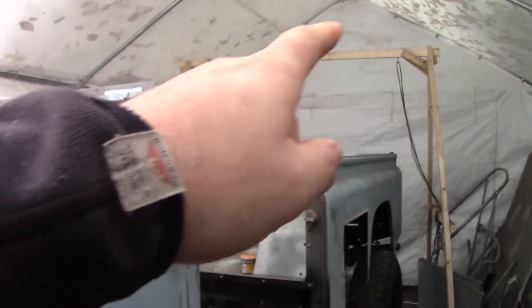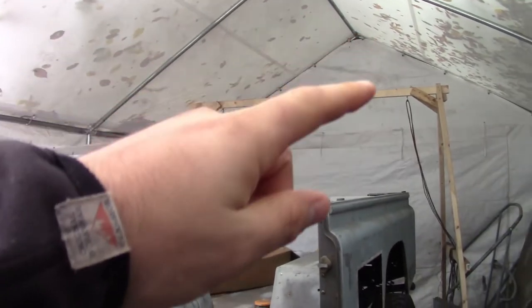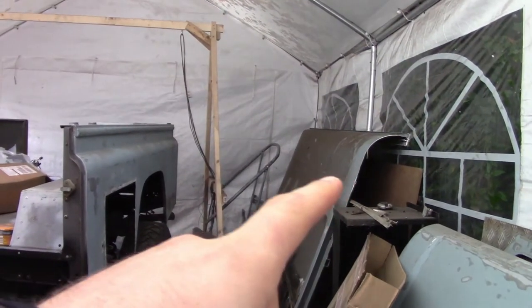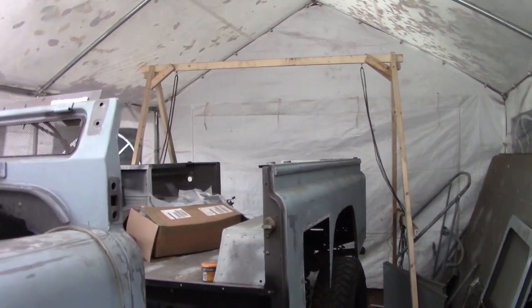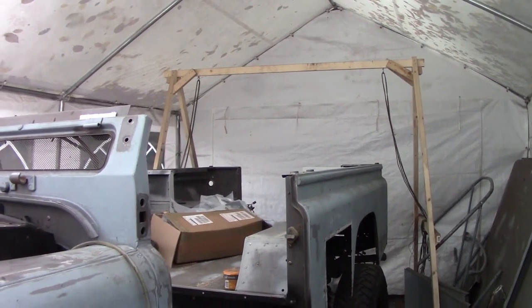I'm going to reassemble all this back — I'm going to reassemble probably the window screen frame, get that back bit of the roof trim put on, and the aim is to take that roof skin, bolt it in the front, see where it overlaps on the rear, mark it and get that cut up, and then we can get that roof section riveted together, sealed and made into the shorter version that it needs to be.